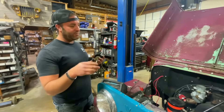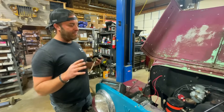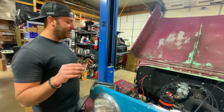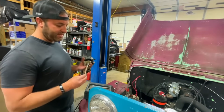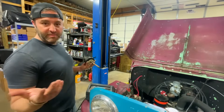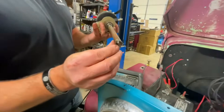This engine came from someone else — I rebuilt it and tried to time it, but could not get it to time properly. It just wouldn't run right. When I was checking it, I thought this thing seems like it's 180 out, and it ended up being 180 out.